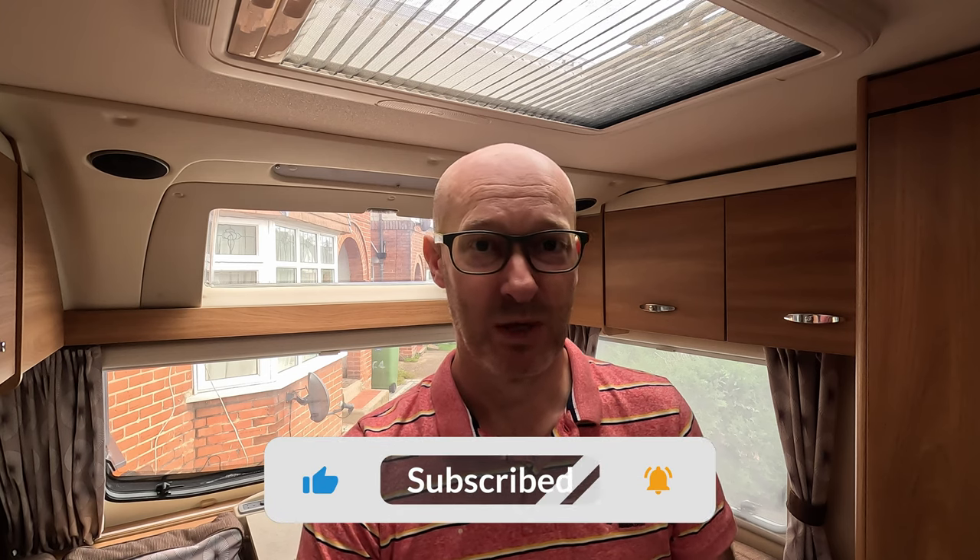In this week's video I'm going to go over some pre-winter checks, have a bit of a wander around the outside and go over some key things you should consider before getting it put away for winter. The nights are getting darker, it's getting colder, and obviously what comes with that is a bit more rain. These are all the checks you should be doing, with any minor repairs carried out while you've still got some warmer weather, so you're not faffing around when it's freezing cold. If you need to do some silicone work it will take longer to go off, so this is the key time to get all these checks covered off ready for the winter period.